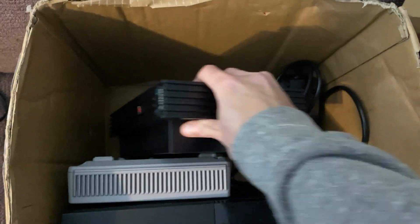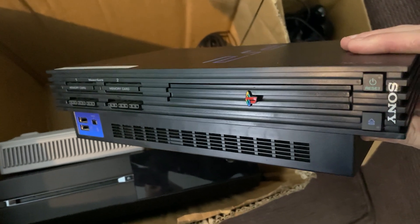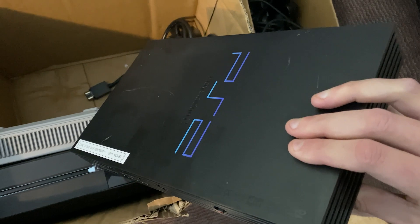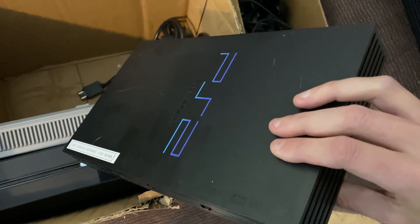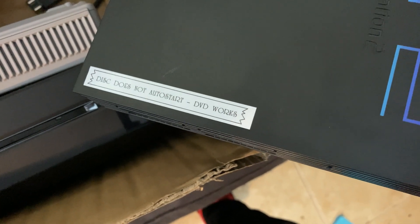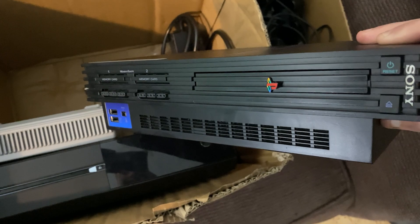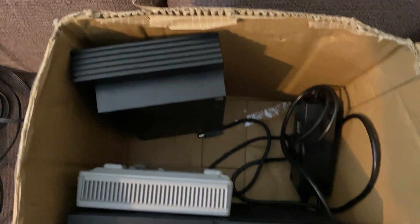This one was in better shape, but the problem was that the video would not come on. There's an easy fix to that — you can run a button combination to reset it. By default it was set to RGB, so I had to reset that to get my component cables working with this one. I put a tag on it: disk does not auto-start, DVD works. Whenever the disk doesn't auto-start it means the laser is just about close to dying. But this one will easily be another $100 paired with two controllers and maybe some leftover games.